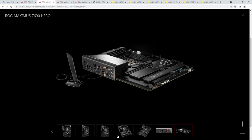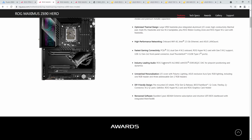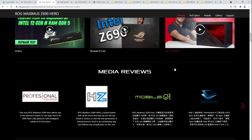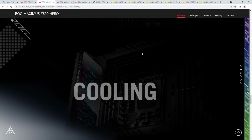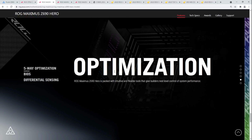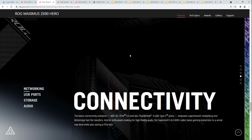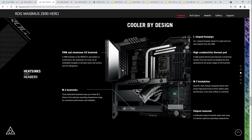Both of these boards have a backplate now. I'm assuming this has a backplate. This better have a backplate. This is $600. Admittedly, the backplate doesn't make the motherboard any faster, but if you're mounting heavy heat sinks, it helps make the motherboard more physically robust. PCBs don't like being bent a bunch. If you're going to have an OLED screen, you should have a backplate. Okay, I can't find anything. I'm guessing it doesn't have a backplate for the board.